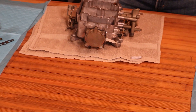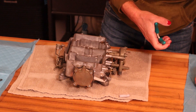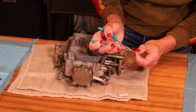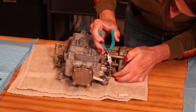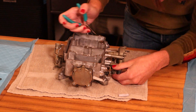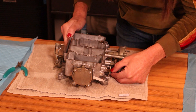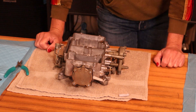Now is the really, really fun part because we've got a little teeny tiny baby cotter pin. This is going to go basically sideways, and what I'm going to do is use my needle nose and fit it in just like so. Then I'm just going to press it down just a little bit — try not to wreck the rest of the carb — and yeah, we're actually good. It's in.